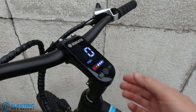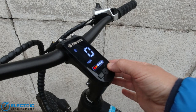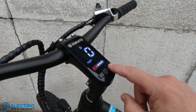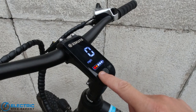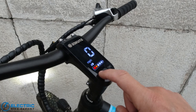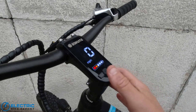There are two buttons on the display itself: on/off and power mode, which selects one of the five power levels. The power level button only lets you go up a level, meaning if you want to go down from five to four, you have to scroll all the way through off, one, two and three. This arrangement is a little fiddly, and a separate thumb control linked to the display would have been an excellent addition. A short push on the power button turns the front light on and off. There's also a USB charge port at the bottom of the display, which delivers around half an amp of power — just enough to stop a phone from running down rather than actively charging it up.